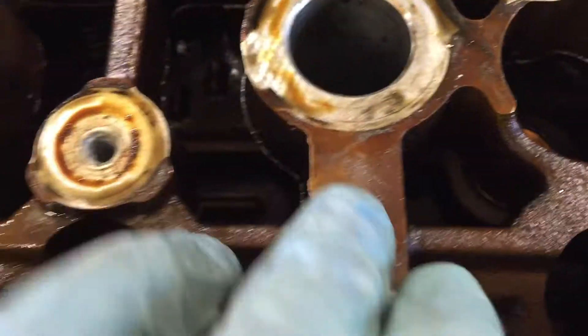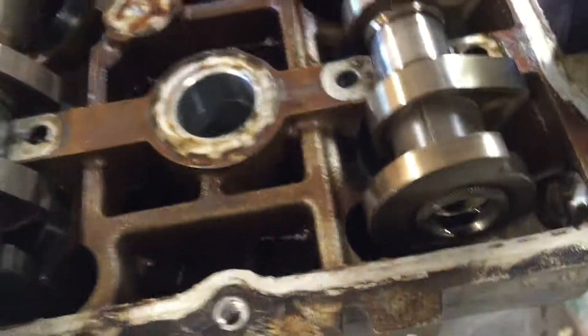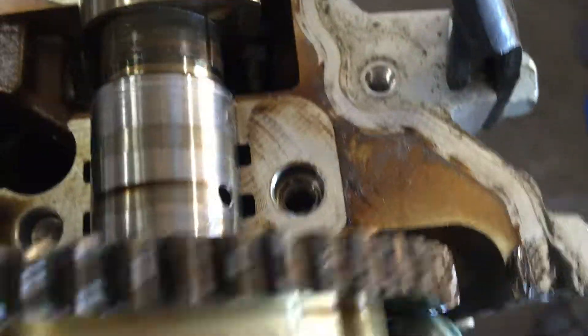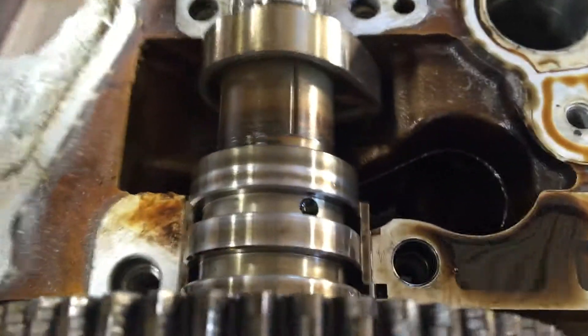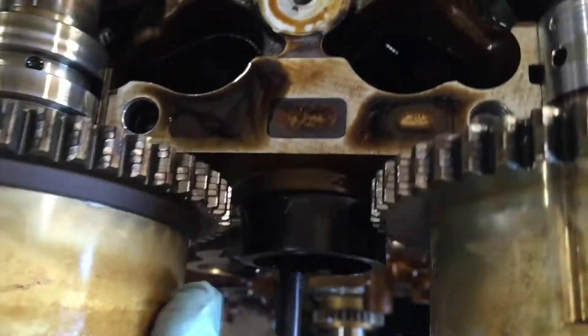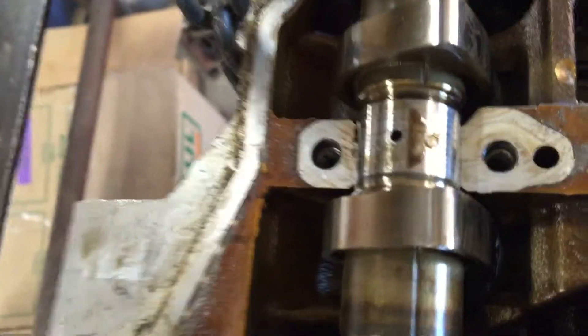This is just straight contact to the aluminum head — kind of a cheap design, cheap way to go. But it is a Hyundai and this is a cast engine; most of these parts are cast, then some pieces have been milled out of that casting. So we don't get bearings here unfortunately. The cam lobes themselves don't look bad at all.